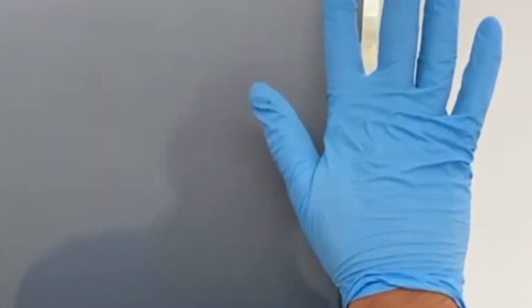So if we go back to the panel — it's dry, nothing's coming off on my finger, a little bit of marking there. But we can see this over-application mottling still here. Hopefully if you come into the top left-hand corner you'll see the stripe I put in there earlier — it's quite a clear stripe just here. But then we have areas in the middle where we did our overlap and feathered by flicking out that are perfect. There's no mottling; the panel's dried out perfectly.